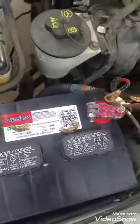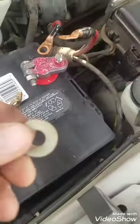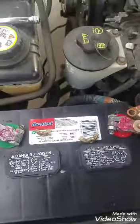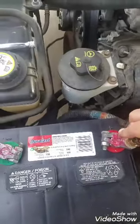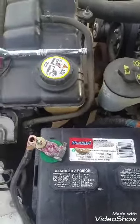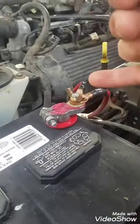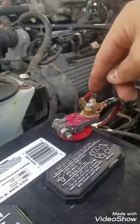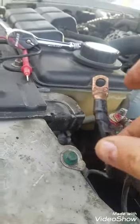I cleaned them up, got some battery grease on it. I'm going to put washers on and then put the cables on, using the wing nuts. I'm hoping that the washer will raise that up a little bit so that when it presses it down, it'll actually tighten it up. I think there was too much space, and as I tightened it, it just got too tight and it wouldn't stay tight on the cable. So that's what I'm doing now, then we'll check it to see if it's charging.